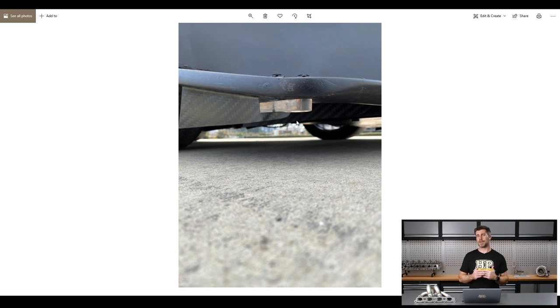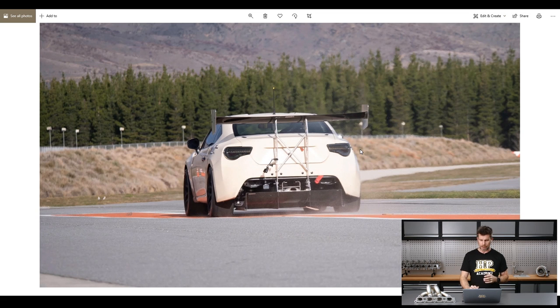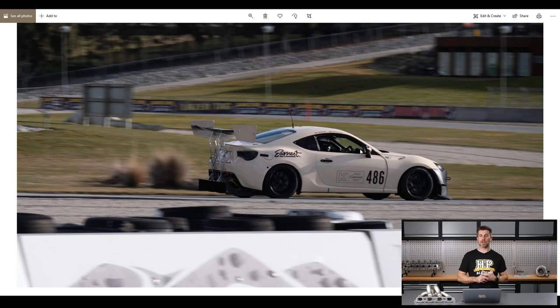We may end up adjusting the actual ride height. The sensitivity of the downforce to ride height is quite critical — essentially within reason, the lower we can run the car, the more effective the diffuser at the rear and the splitter at the front become. Back in the shop, we ended up with some end plates for the rear wing that have been a work in progress over the last few months. Everything went really well out on track with no real problems other than a minor alternator issue. The front bumper is a new in-house built fibreglass bumper by Brandon and Jimmy, our fabricator, designed to suit the new front splitter and seal it for maximum effect, while also channelling airflow into the coolers on the front of the car.